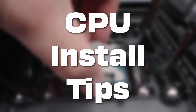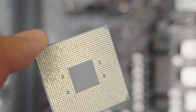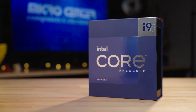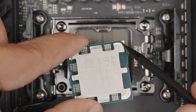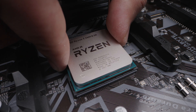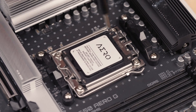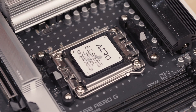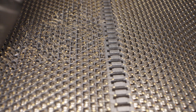Here are a few helpful tips for installing your CPU. Don't handle the CPU until you're ready for installation — it may be pretty to look at, but it's best to keep it in its packaging until you're ready to install it. Hold the CPU firmly on the sides of the chip; it's okay to handle the sides with your bare fingers. You want to make sure you have a firm grip on the CPU to avoid any accidental drops. LGA motherboard sockets have covers to keep the pins safe when the motherboard is not in use — leave the cover on until the last possible minute to avoid any accidental damage to the pins on the board. All it takes is one dropped screw or even dropping the CPU on the socket to damage the pins.